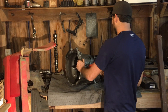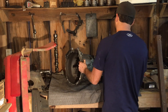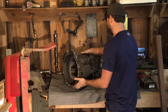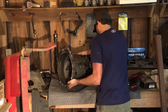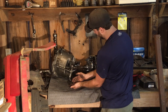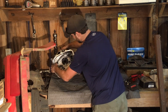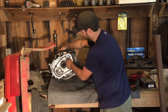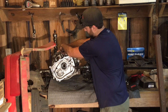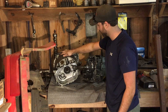I already have all the bolts out, so I'm going to split it off and take it over to Wesley's dad's to get it machined off the dowels. There are some pins that can fall out of here when splitting. These little pins go on the shaft and engage a little cross down inside — this is what moves back and forth, and this is where our detent pins will go through.